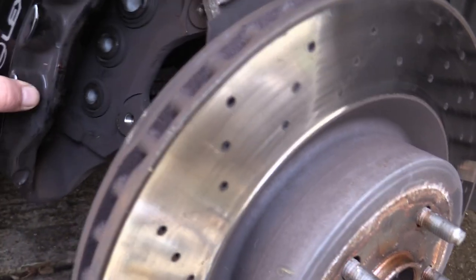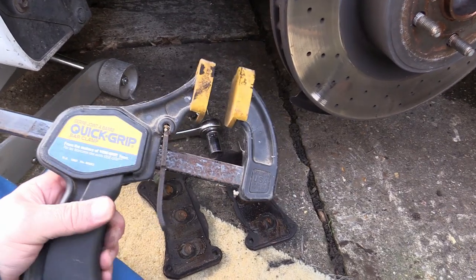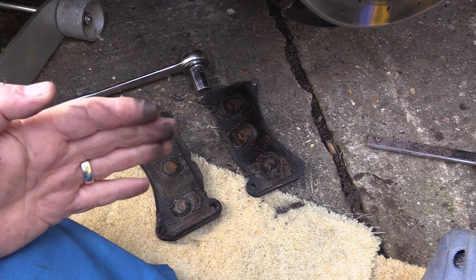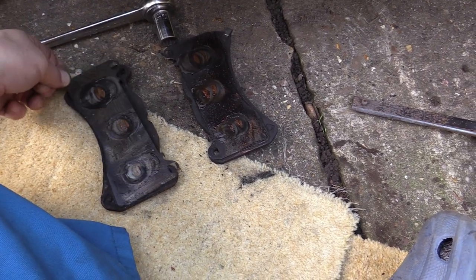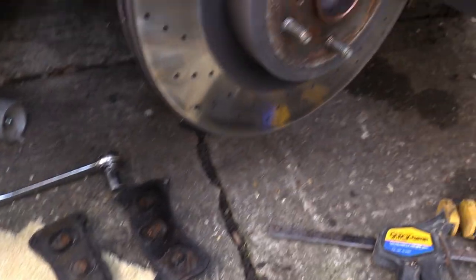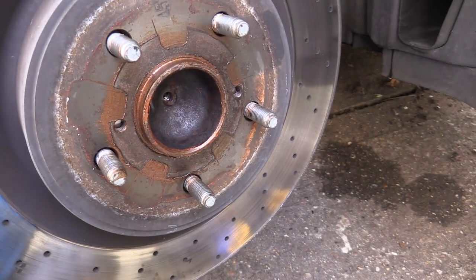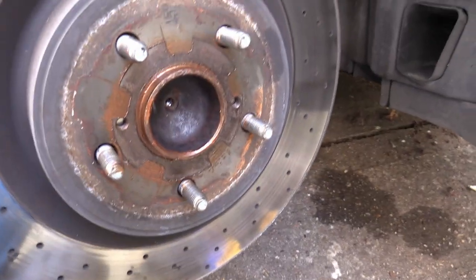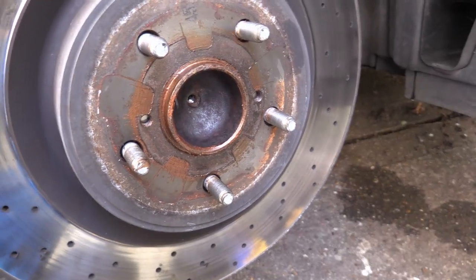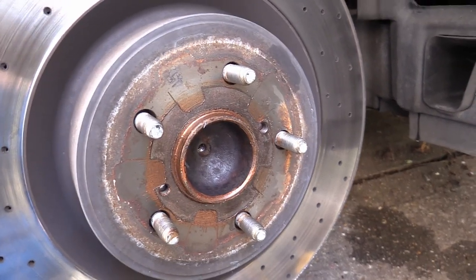The caliper is on a bungee around the suspension to stop it pulling on the brake cable. I used one of these clamps to release the brake pads — they were quite tight — and push the pistons in a bit, which will help us get the new ones in. The brake pads appear to have shims on, which I'm assuming is for anti-squeal, so we'll keep those. The disc is solidly on there — those two little holes are for screwing in bolts to release it, since it's probably rust-welded on over time. I think they'll be M8 or M10.